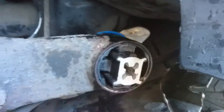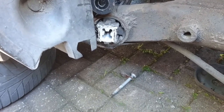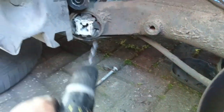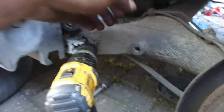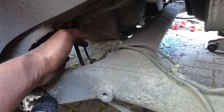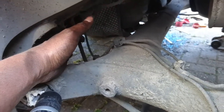I'm going to put the bracket back and then go to do the other side, which should be very straightforward. Now I want to point out - you see this pipe here, that's a brake fluid pipe. Make sure it doesn't get too tight; you don't want the suspension hanging on this, because if it gets broken you're going to be in serious trouble. I'll get the jack and lift this a little bit so it doesn't get too tight.